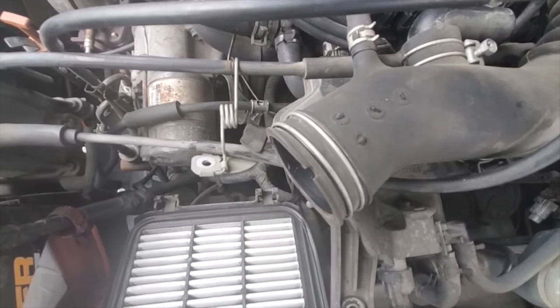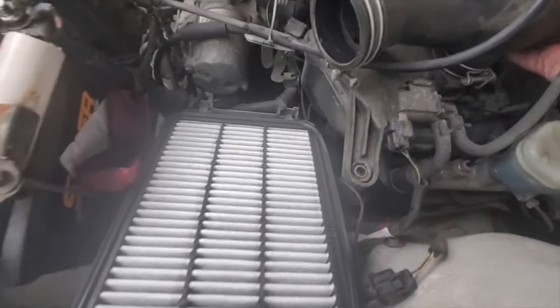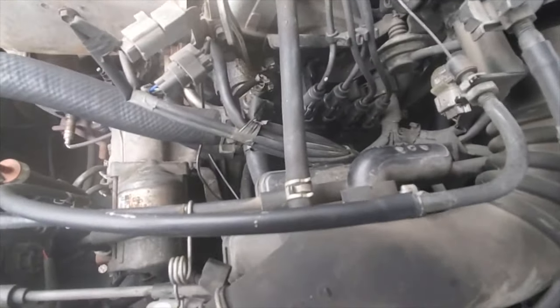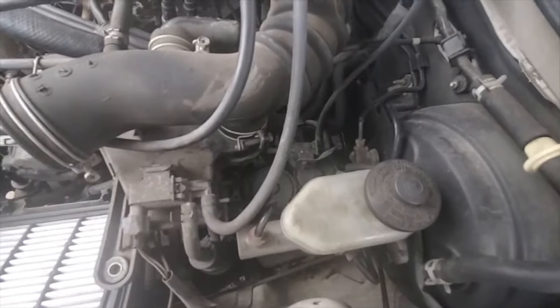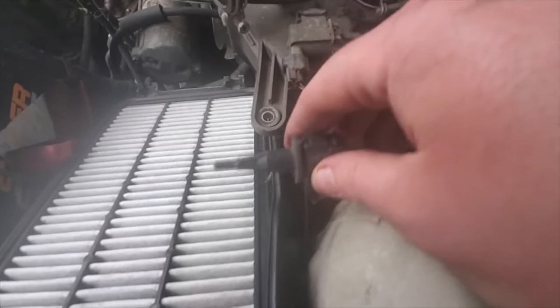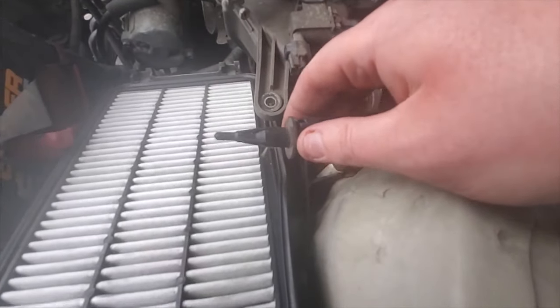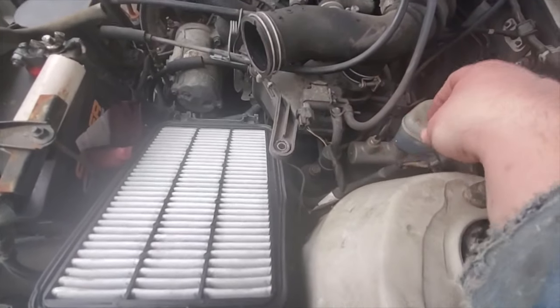You can see there's two clamps here and here and a 10 millimeter that I removed off camera. Optionally, you can take that throttle cable and sneak it out of its home. Now pretty much all that's holding it in there is this little hose — I'll have to get a vice grip or something to remove that. Also, the intake air temperature sensor, this thing here — you can either undo the electrical connector or you can just screw it on out. That's what I did; just toss it off to the side.